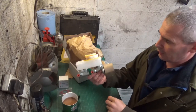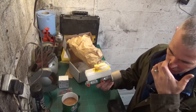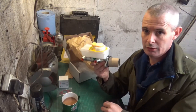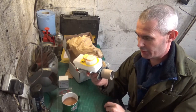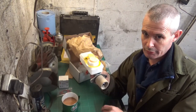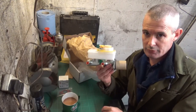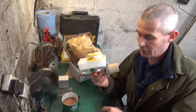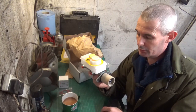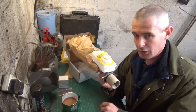So there we go. And because I've renewed the brakes on the car, front and rear — it's got new cylinders, callipers, seals, you name it — I thought it would be a good idea to renew the brake master cylinder as well. The car is 30 years old and that master cylinder has probably never ever been changed. So because I've refreshed the brakes, it would be rude not to do this. Plus this is a safety critical part of the car, so your brakes really need to be spot on.